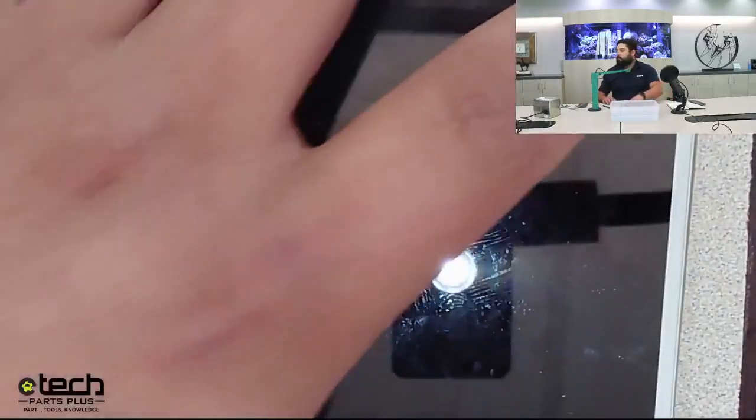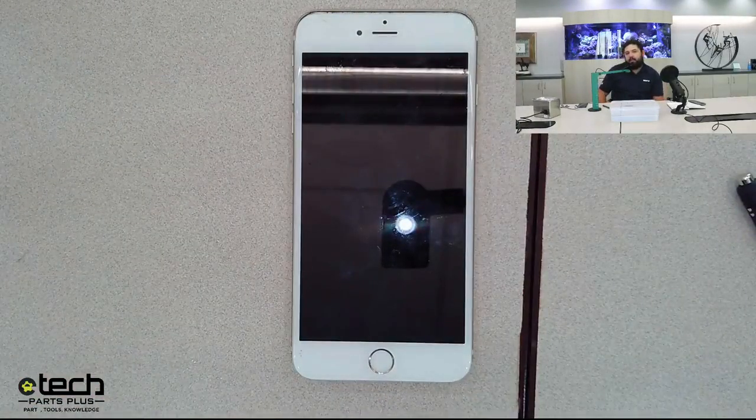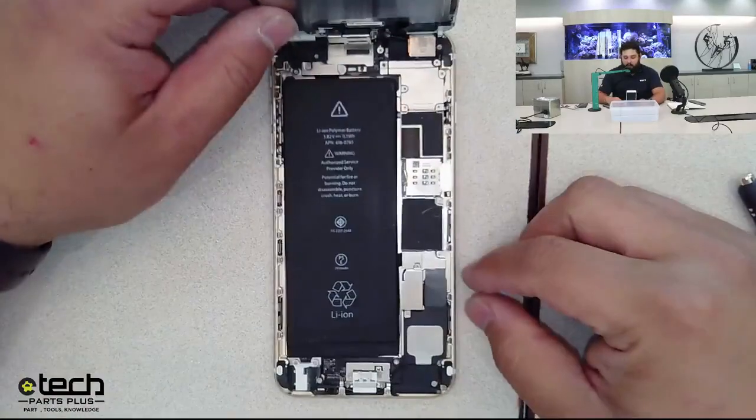So when they're red like that, that means liquid came in contact with the LCI and it was enough to trip it. Sometimes humidity, extreme humidity or moisture can do that too. So if you have a customer that tends to, say, take a shower with their phone in the shower stall or the bathtub or anything like that, even if it doesn't come in direct contact with liquid, it can still activate it. So that's a caution thing to be aware of as well.